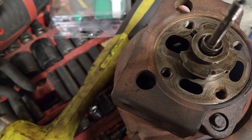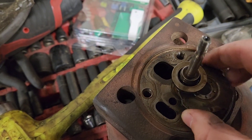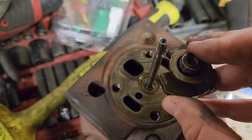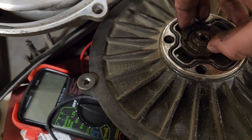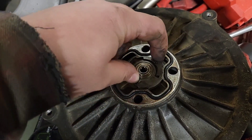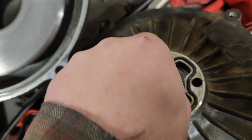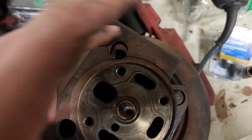When doing your rebuild, everybody's going to try and sell you on a 360-degree bearing rebuild. What that does is replace this with something completely wrapped around this center section bearing. This guy just pops right up — you may have to do a little pulling — and it sits in here one way only, just like the housing. If you try to clock it another way it won't go in. The 360 rebuild kit is designed the same way, so you can't screw it up.